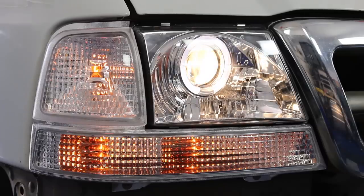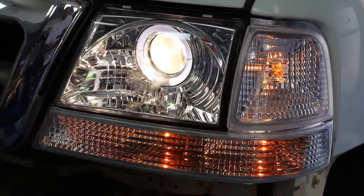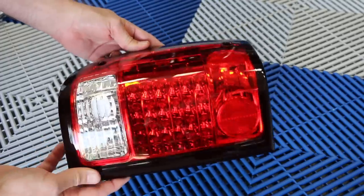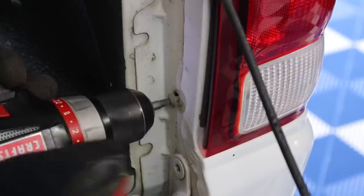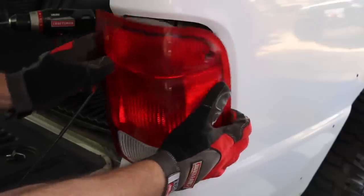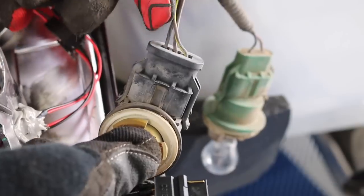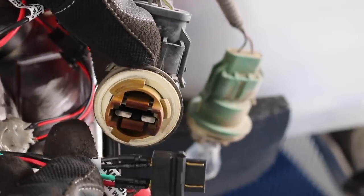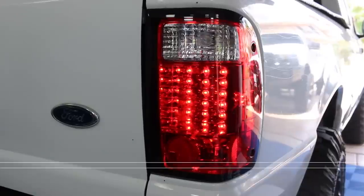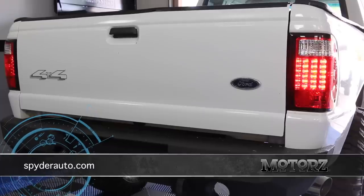It looks way more modern. Now that I'm done up front, I want to make the same difference to the taillights, so let's head to the back. The Spyder Auto taillights for the Ranger are modern as well and feature LED brake lights. All that you need is a Phillips screwdriver to install. Begin by dropping the tailgate and removing the two fasteners on the inside, then the two on the outside. The taillight will come free after that. Remove the two factory bulbs. For the brake light, use only the four-wire connector on the Spyder Auto taillight, then match the black wire to the black wire of the factory bulb socket. Install the clear bulb and then the completed light assembly. Grab a buddy to help you test it out. To check out more styles of lights for the Ford Ranger and many other vehicles, go to SpyderAuto.com.